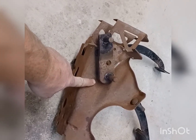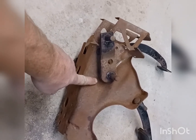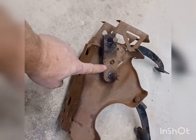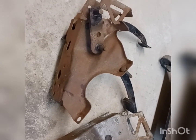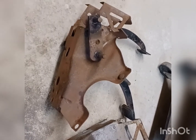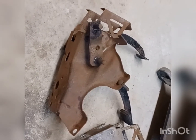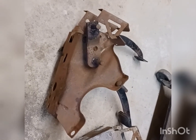This bracket came out of a parts car I've got laying down in the field — I think it's an 89, it's a V8 car. So you guys that decided to do a V8 swap, five speed, or whatever in these cars: 78 Zephyr, which is the first year of them, I think all the way to 93 should probably work, because the pedals in my 91 came out of an 87.